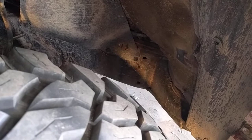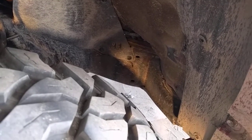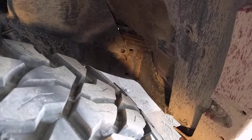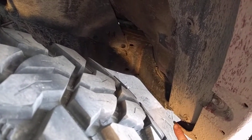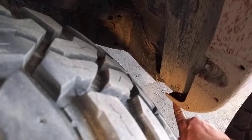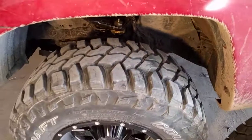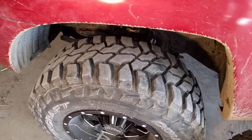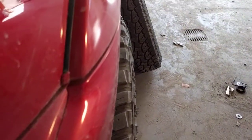Now they're not rubbing on the back here like a lot of people are doing the chops, but I haven't compressed the wheel yet into the wheel well. When they do compress, they do rub here a little bit under compression, so I'll probably end up having to snip this off. I haven't had time to go out and actually stuff the tire to figure out exactly where they're rubbing.